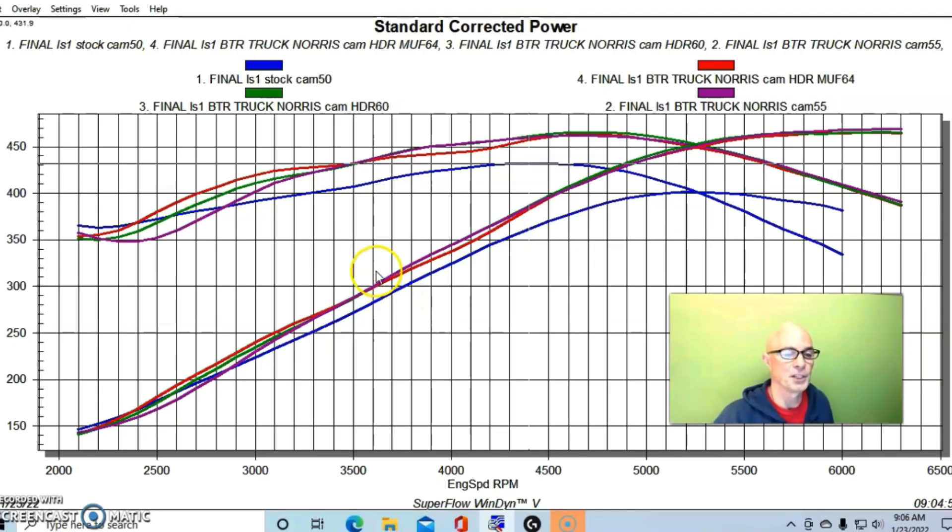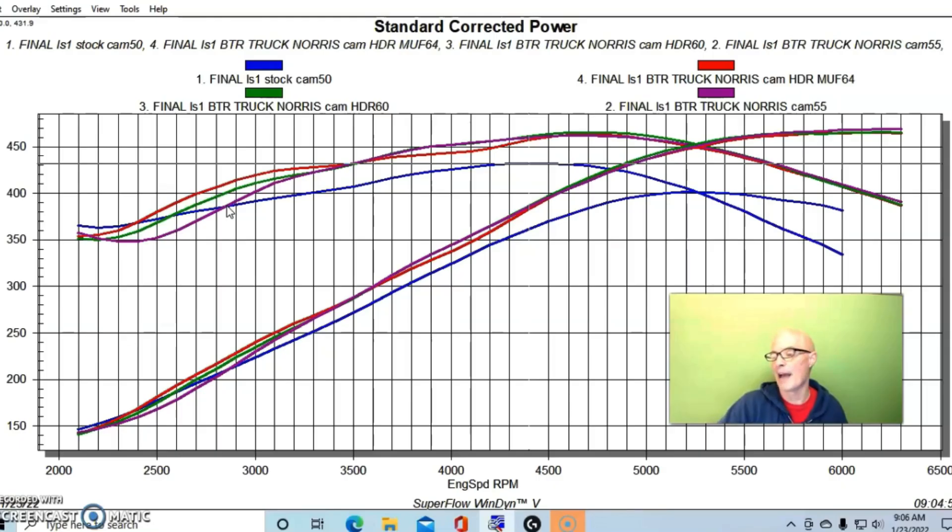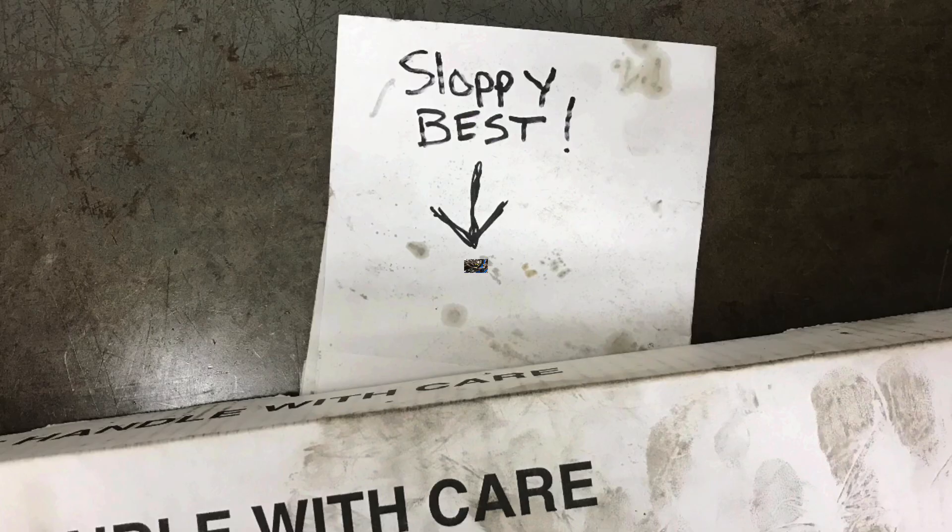This is all a scavenging effect change we're seeing — both from the change in header primary diameter from 1-7/8 to 1-3/4, and very much so from the collector length extension. We also see this with collector designs — the style of the collector, whether it's a merge collector, can change this scavenging effect. Going from 1-7/8 with a short collector extension to 1-3/4 with a long collector extension, we changed the crossover by almost 500 RPM — improving torque essentially across 500 RPM. And guys running these kinds of camshafts are usually going to have a full exhaust, not an open header, so the camshaft is even more effective when run the way you'd actually use it in a vehicle.